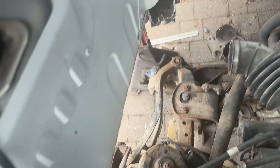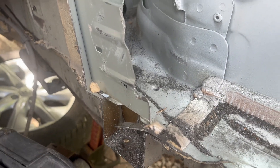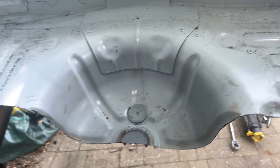Our suspension is going to come up here. Same on this side - I need to cut away the member I've left in for this one, so I need to chop this out anyway. That needs to go all the way - you see where the engine mount is going to be sitting, it's going to be basically - as you can see I've chopped out that side there, I need to chop out that piece there to be able to get the engine mount to come up and sit up here somewhere. At least that is the thinking. It looks like I've come enough forward, got enough at the rear, and you can see where the rear mounts down here obviously are going to sit on a beam going across.